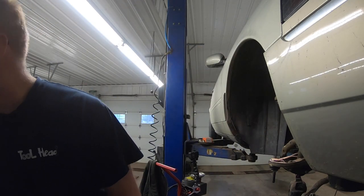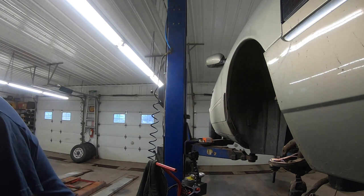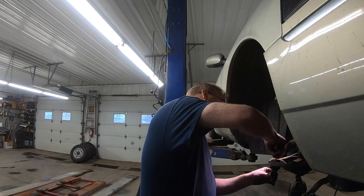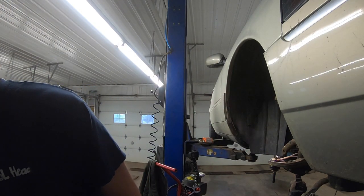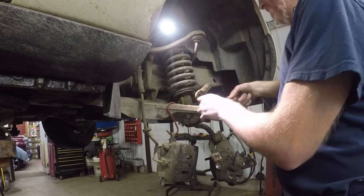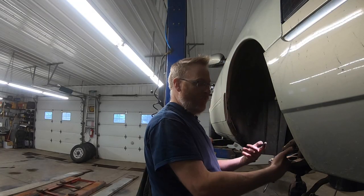Now that that's in there, we can put on our new snap ring and our grease fitting, then we'll reverse the whole process putting it all back together. We'll spin the grease fitting in there once we find the threads — that's a 10mm. On the other side I had the grease fitting face the front of the vehicle because it seems to be a little easier to get at than the back, with this sway bar link kind of right there in the way. When you're done turning it, just make sure it's pointing out the front a little bit.